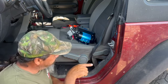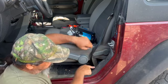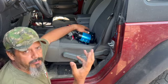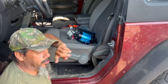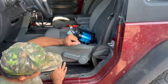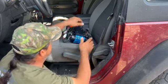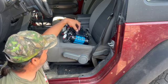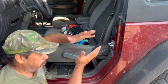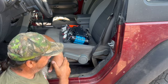One of the brackets I found is kind of a horseshoe shape — basically a flat plate that fits under the seat. It has two little ears that go under the back of the seat bracket to hold it down, and you bolt your compressor in from the bottom. The other option is you unbolt your seat from the seat rail, turn your compressor upside down so it sits under your seat, mount the compressor to a bracket on top of the seat rail, and then the seat goes back on top and sandwiches it all together. Either one is a pretty good option — I'm probably going to go with the floor mount one.